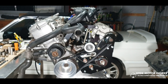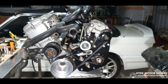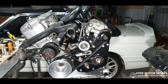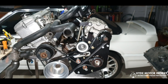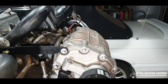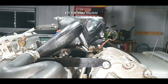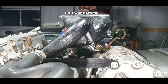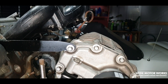Designing this build, I wanted to keep the symmetry as close as possible to the natural 30-degree slant of the way the BMW M10 engine sits. So the supercharger also sits at 30 degrees but in the opposite direction. You can see the existing E30-style plenum — and I think the late E21-style plenum — sits neatly above where the supercharger sits.